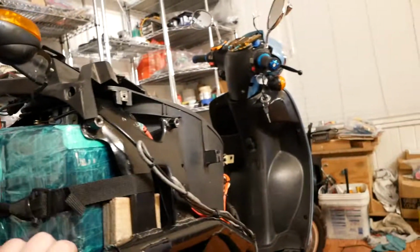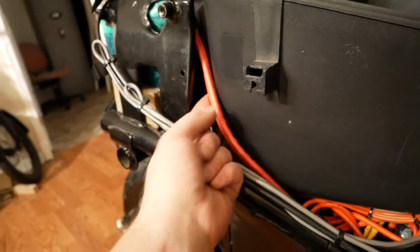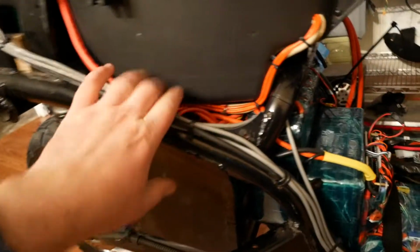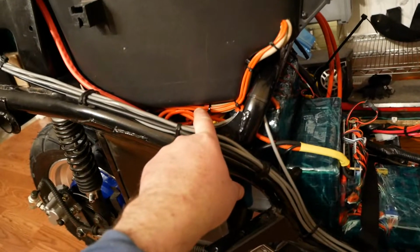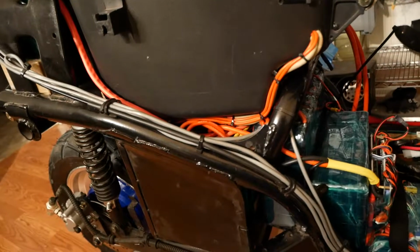So anyway, that should pretty well protect those corners. And that battery pack is, of course, jammed into the back side of the underseat compartment, so the only thing it can do is basically stay put. It can't go anywhere. I can't really show this because this is all bolted in place, so that back battery pack is in there. Anyway, here are my battery wires coming out from there, and that's all 8 AWG wires. Up underneath here, right there, is my terminal block, and there are 3 sets of 8 AWG wires going into that thing, one from each one of the 3 battery packs.